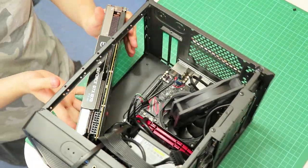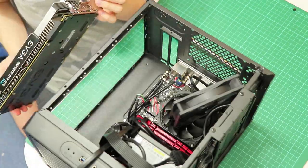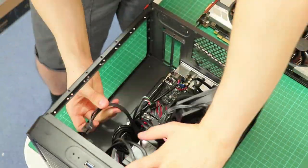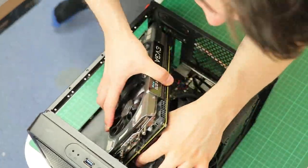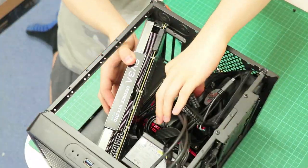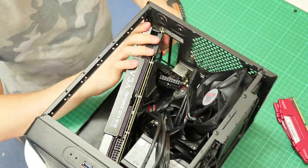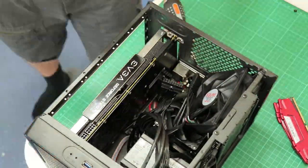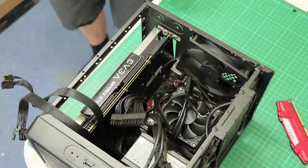After unscrewing the fan to free up room around the rear PCI Express slots, it wasn't enough. So then I tried removing all of the power connectors from the power supply unit, which again wasn't enough. So then the RAM, SATA connectors, and USB 3.0 connector all needed removing as a last-ditch attempt before resorting to getting the pliers out, like on the Corsair Air 240. Luckily, that wasn't required since with a little scuffing here and there, I was able to install the card.